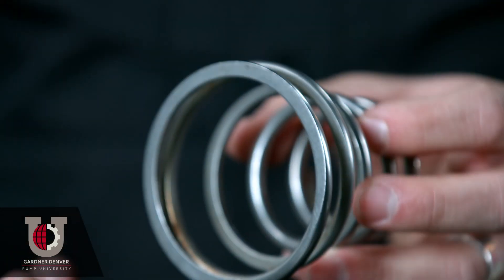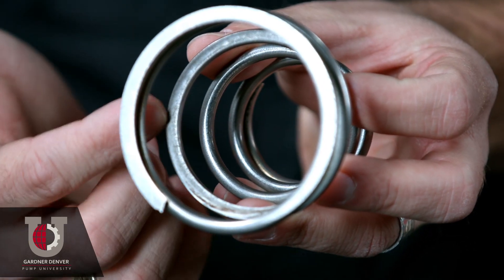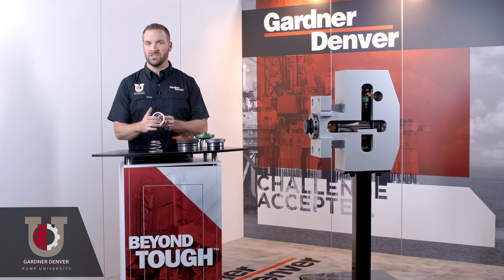Next, change your valve springs out along with your valves. Springs tend to be forgotten parts, so we ask that our customers change them out on a more regular basis. When you want to notice signs of wear in your spring, look inside your coils for flat spots. These are considered washouts and they will eventually lead to a break in the spring, so always remember to check these and change them out along with your valves.